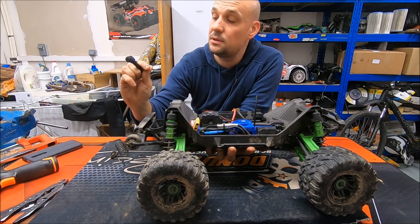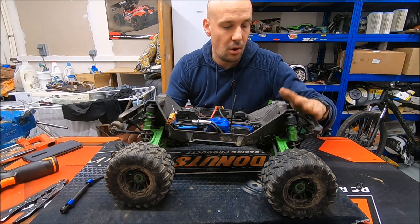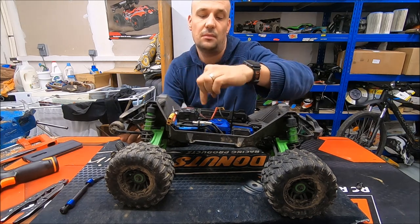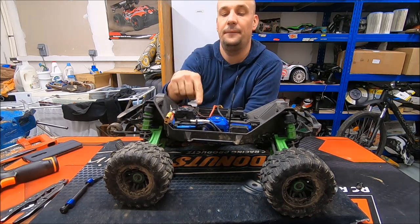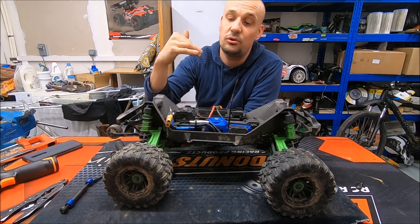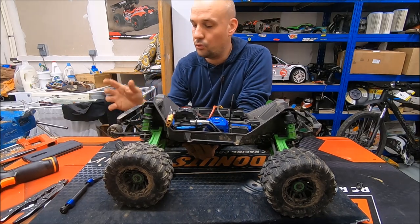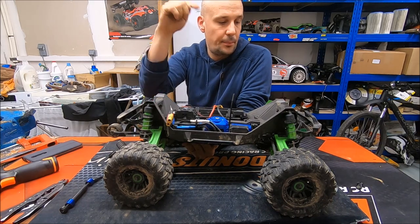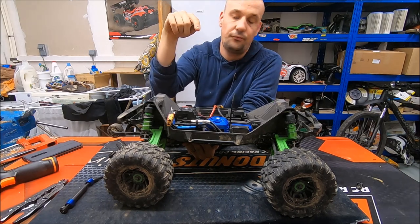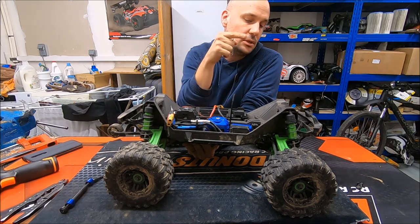I tested it and for the moment it's good quality. That's the mods I've made on the Maxx for now. Maybe I would change the motor — it's a good motor but it gets hot easily, so I'd try a less KV and bigger motor. I'll put all the references and links for the things you need to do these modifications in the description.